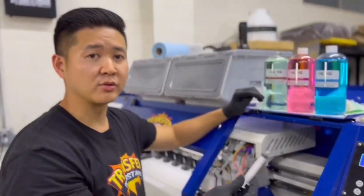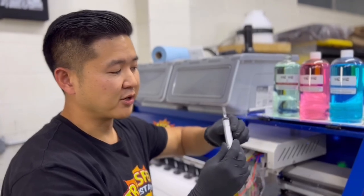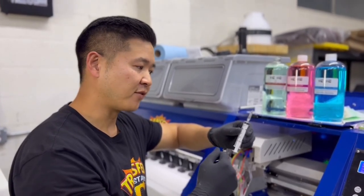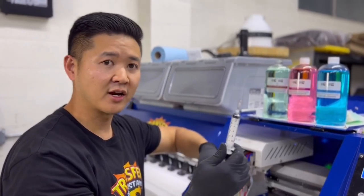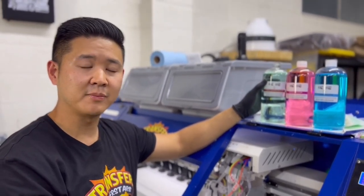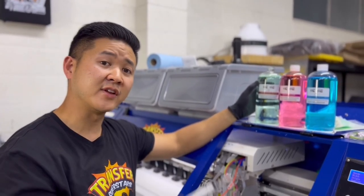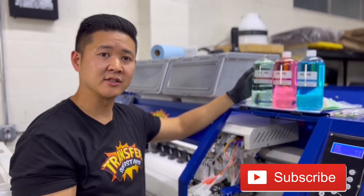Make sure you guys are also using a clean syringe. I know a lot of people like to reuse these, but once you put a lot of cleaning solution through it, it gets really stiff. And if the pressure is not consistent, it may delaminate your printhead. So keep a lot of these and try this solution. Give it about 30 minutes and hopefully that will clear things up. I'll drop a link below for where you guys can order this from. If you have any questions, make sure you guys leave a comment and I'll be sure to answer that for you guys. Thanks for tuning in.